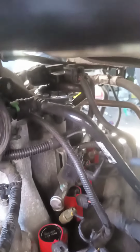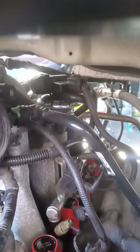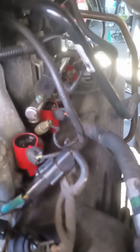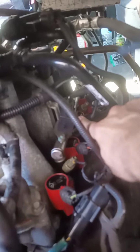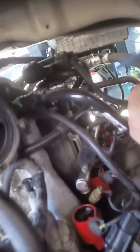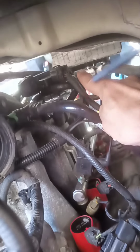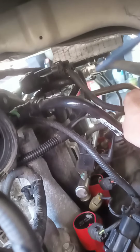So guys, there's the EGR and the solenoid reconnected. You had 2 tubes in on the side of it, as well as another one that another tube plugs into the fuel rail here, into the fuel rail pressure sensor. The EGR comes with all new tubing on itself. Any connection that goes from the solenoid to the EGR comes with new tubing. 2 tubes plug in onto the side of the solenoid.